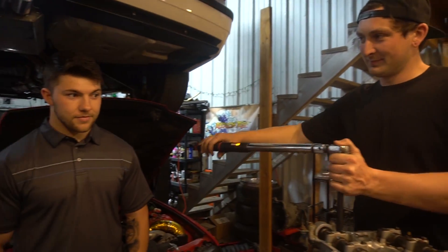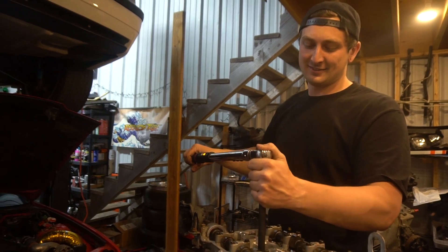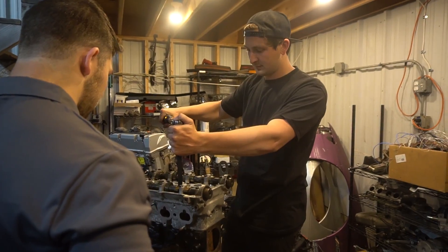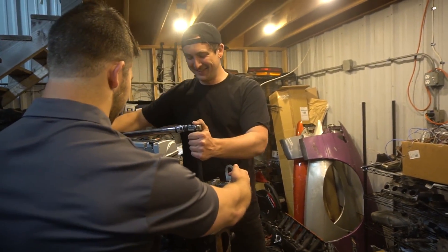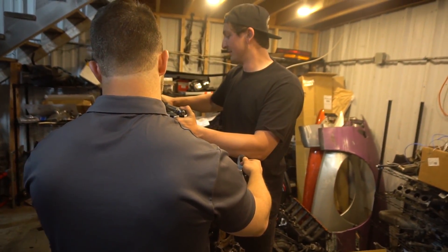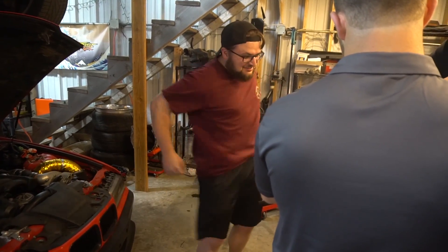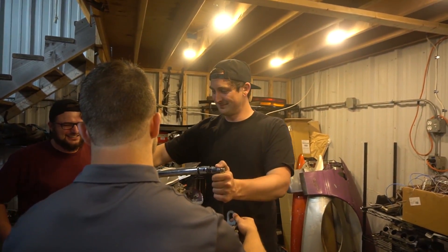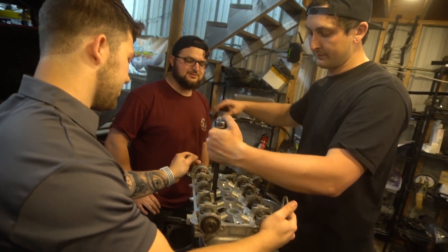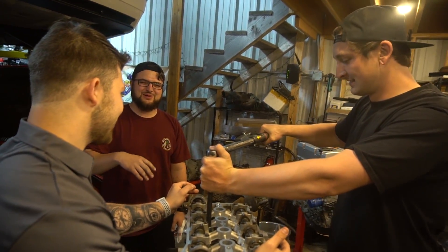What's the next pass after 22? Probably something like 40, then 65 — it's on the instructions. RJ has given up on life and started wearing a fanny pack — he claims it's peak performance. Oh boy, that was not 20 foot-pounds on that pass. Fanny pack tricks! The torque wrench is really nice — definitely not a Pittsburgh.